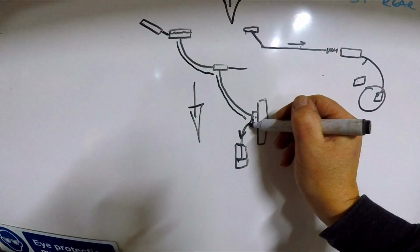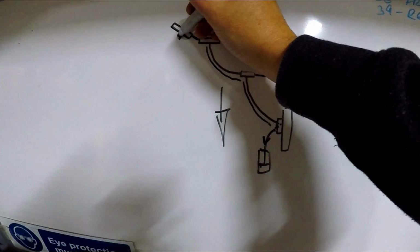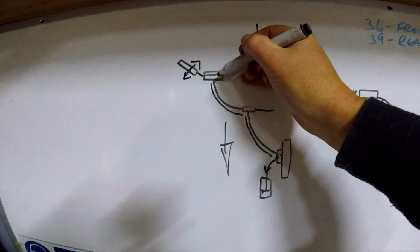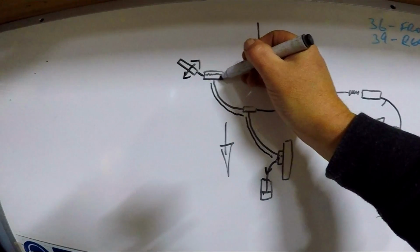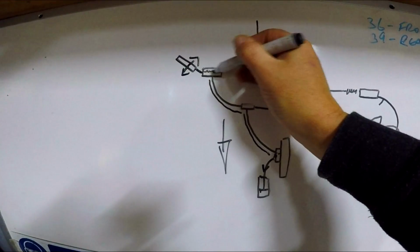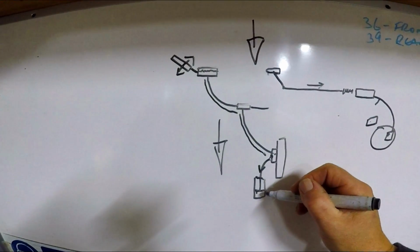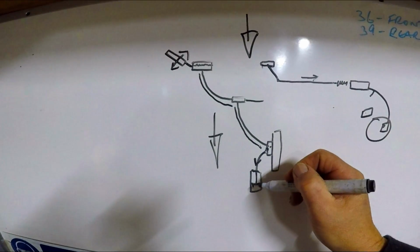You leave this valve open and you're purging by the lever. All you're doing is purging that lever and purging that fluid down. When this reservoir gets underneath where the piston actuates, it will not have any pressure. You have to keep this reservoir at least at the halfway point on here. You will see the colour change in the bottle when your new fluid is coming through, so you know that you've purged the system, and that's what we're going to do.